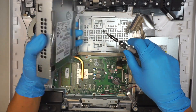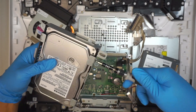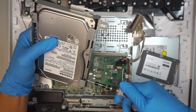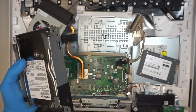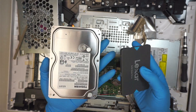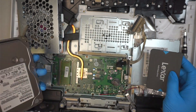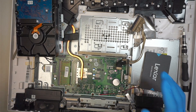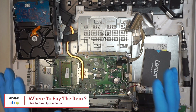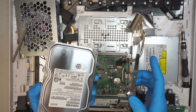At this point, I can only explain it — I don't have the video to continue. There are two ways you can upgrade your hard drive. Option one is to clone the hard drive over to a solid state drive, which is great if you want to speed up your computer or replace a broken hard drive. This is a regular 3.5-inch hard drive, and this is a 2.5-inch drive. You can clone it using a program called Acronis — I'll link it in the description where you can get it from Amazon or eBay. Buy the software, install it on a different computer (not this one, since we took it apart), and use the cloning process.